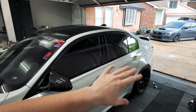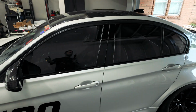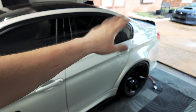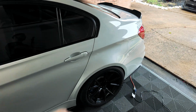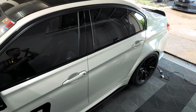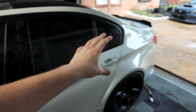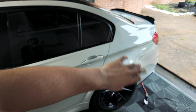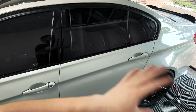The largest time consuming part was the rear diff subframe bushings. Getting everything off the first time really isn't so bad. Getting the exhaust and the drive shaft disconnected and the subframe lowered, that's really not such a big deal. But pushing out those 2 bushings on the rear on the subframe takes forever. You only have to push out 1 bushing, and it has this metal sleeve that it sits in. There's just no space between the diff and the rear of the subframe, and so you just fight for room to get a press kit in there, and it takes a ton of time.